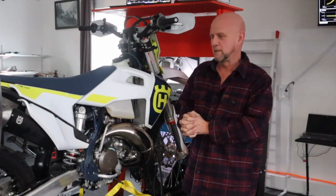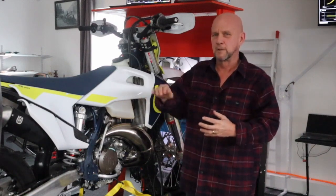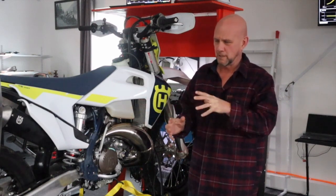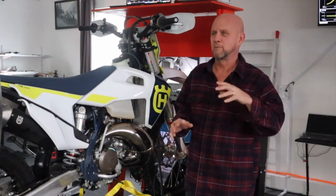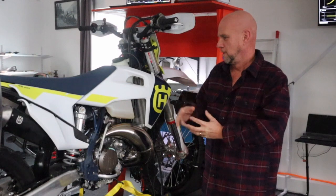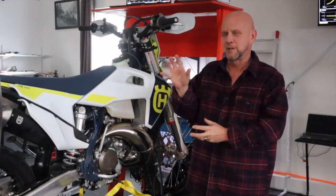It's also important to know the actual air/fuel ratio — I think that's critical. A lot of times you can really lean things up and gain some top-end power, but you wouldn't be able to ride it that way on the track; it would be way too lean. Sometimes you might make a power shift but it might actually go rich, and you lose power — but with the air/fuel ratio data, you can see what's happening and fix it.